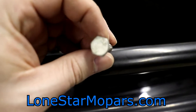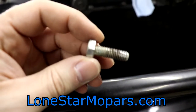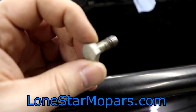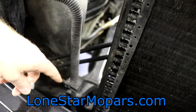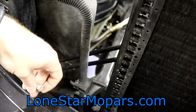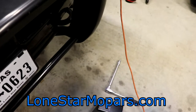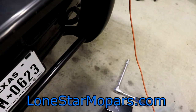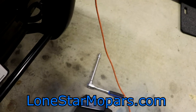It's so nice when there are stampings on the bolt — I know if it's SAE or metric. In this case, 8.8 tells me it's metric. This is an M8 by 25 millimeter with a flat washer and a lock washer. That's what comes through the grill guard support and anchors into what looks like a rivet nut. So this is what I'm going to have to order to replace the missing one on this side — it's been loose and missing for a long, long time. I'll finally take care of that. Going to thread this one back in. First time using that Gador ratchet down there — the extension and socket are amazing.